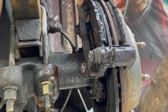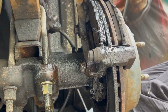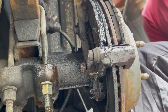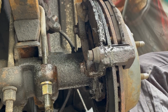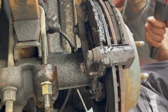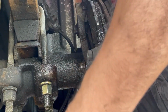Okay, so continuing on. Ready to get the whole brake setup off. So I just broke these two bolts here. This is your caliper mounting bracket. Those are 18mm. So now I'm going to try and use this impact on it because they're still really tight. Try not to bump the camera too much. Scoop the hose this way.